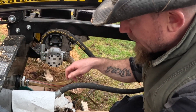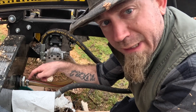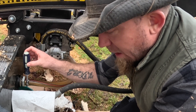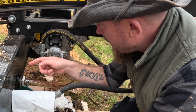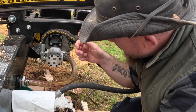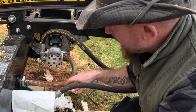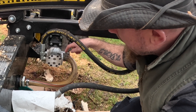I checked one of the smaller hoses — it had oil residue on the outside and collected some debris from splitting, and the hose clamp was definitely loose. Pro tip: a harbor freight socket driver fits on top of these hose clamps. I removed it and checked — there's nothing left in the hose, so whatever came out through the reservoir is all of it. I cleaned up the gunk from the hose so no debris gets into the reservoir and clogs the filter, then tightened the clamp back up.